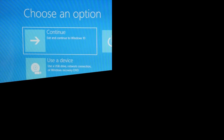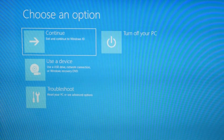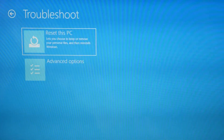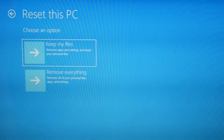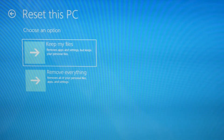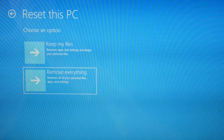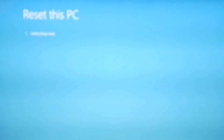Which I know is sad — you lose your data — but we're trying to save the computer here, and this is honestly one of the next steps. Once you get to this screen, hit Troubleshoot, then Reset this PC. We're going to do Remove Everything. You could try the Keep My Files option first, as it does occasionally work, but Remove Everything is really the more likely fix.